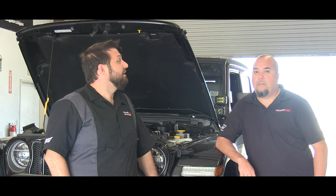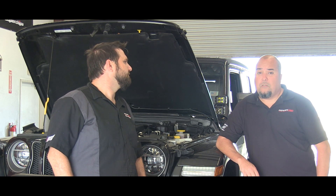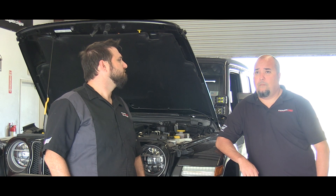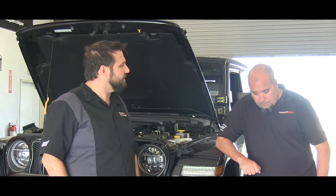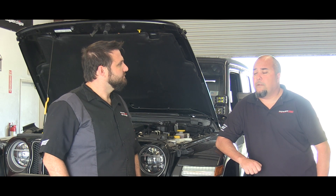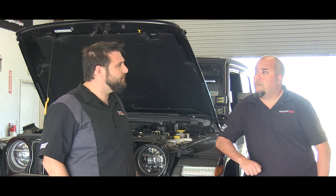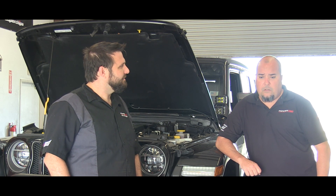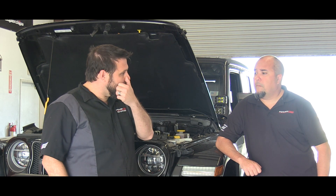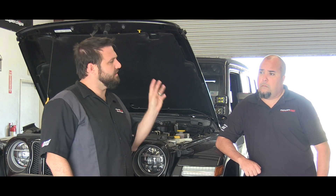I imagine they gain these efficiencies through the direct injection as well as a few other things. It also has a very well-designed boost control strategy, which makes it a little difficult to manipulate. At 26 pounds, how much room does it have? It probably only has three or four pounds of headroom — so it's wound pretty tight. That said, on some of the initial work you've done you made some pretty good power regardless of the boost — we've had as high as 20 horsepower and 30 foot-pounds, and I think there's more to find.